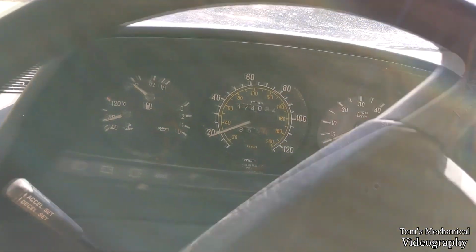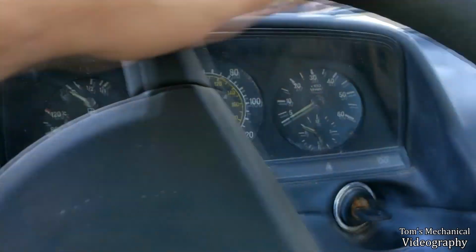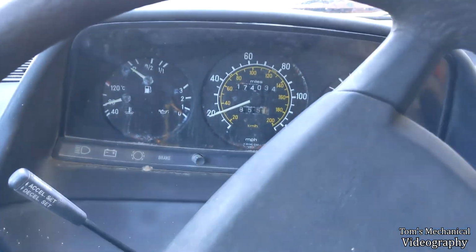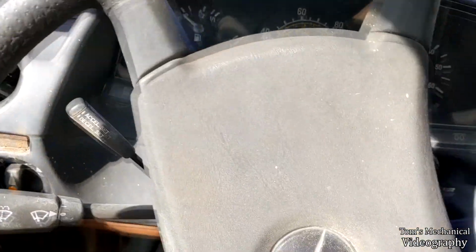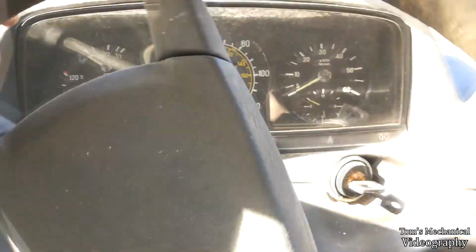So, yeah. I'm gonna just do another lap or two until she gets about 90 degrees, unless she now decides she wants to stay at operating temperature. And then I'm going to pull her over and put her up on ramps. And then, actually, before I put her up on ramps, I'm gonna check the transmission fluid level. You know, actually, I think I'm gonna pull her over now, just because I don't want her getting much above operating temp, because it messes things up. I want to check the blow-by at 80 degrees, because I think the block is just overheating, and that's increasing my blow-by and reducing my compression. So we'll check on that real quick.